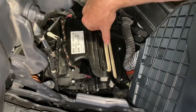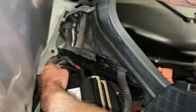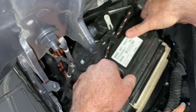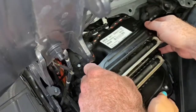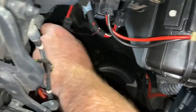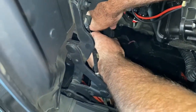You're going to have to disconnect a few clips. This one right here on the top just pulls out. I think the only other one is down underneath, which is the main power. Pulling this thing out, you want to take it easy. Make sure you've got everything loose and make sure your screws aren't so far out that they'll come all the way out. The best way is to lift up and twist it as it comes out. It pretty much just lifts straight out. Then you have this connector here — you pinch at the bottom and pull. That's it.